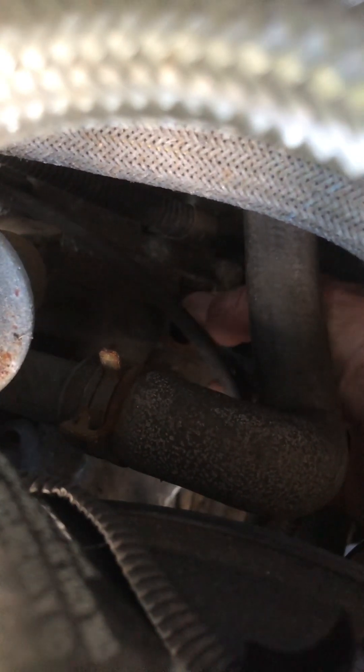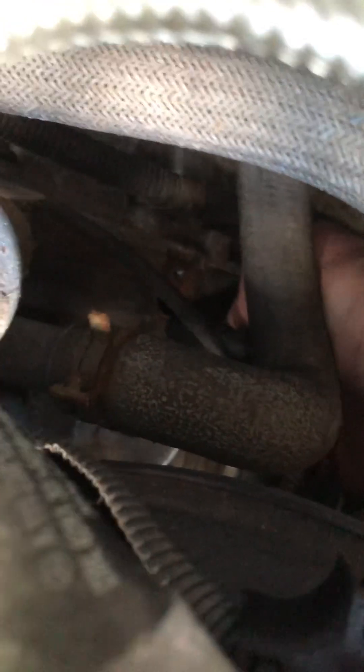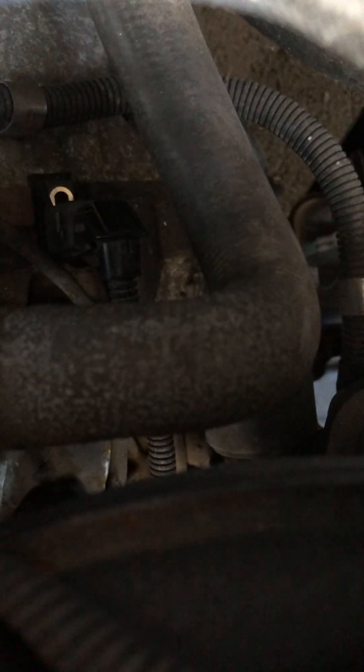Now I need to get it into the hole. You can see the hole — there it is. So there's the hole in there, and there's a cable down there as well. Let's see if I can slide the sensor in there. There we go, slid down. That's rather good. Make sure that it's twisted so it lines up properly. Just pop you down there. It's very dark down there. I'm going to get the Torx bit again and make sure this is definitely pointing backwards, otherwise the screw won't go in that hole.